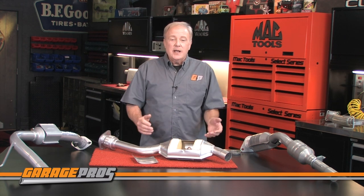Before you purchase your new catalytic converter, make sure you know the real reason for the failure of your original converter, like a bad oxygen sensor or mass airflow sensor, worn spark plugs or vacuum hoses. If you don't correct those issues first, you're risking damaging your new catalytic converter when you install it.